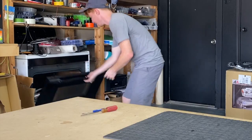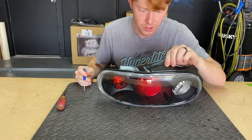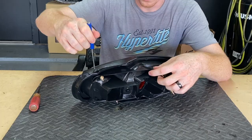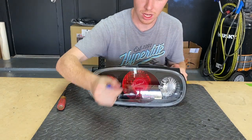That's eight minutes. Probably wear gloves. On the Miata taillights, there are a few different clips you're going to want to get — one, two, three, four. You're going to want to release those before you start prying the lens off, otherwise it will snap right down here most of the time.